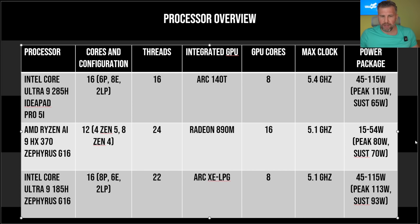The Intel Core Ultra 9 285H has 16 cores and 16 threads, but most importantly the peak power can go to 115 watts. We see that for just a few seconds before it throttles down to about 80 watts, and then after several Cinebench runs it goes down to 65 watts sustained. The Zephyrus G16 tested for the 185H and Ryzen AI9 HX370 could go to higher power limits — the Ryzen peaks at 80 watts and sustains 70 watts, while the Zephyrus G16 with the 185H peaks at 113 watts and sustains 93 watts continuously. This provides a lot more power throughput for high-power continuous testing.